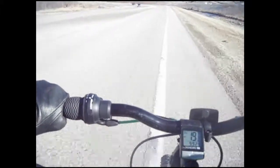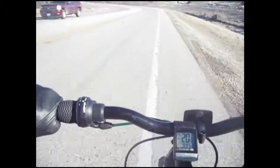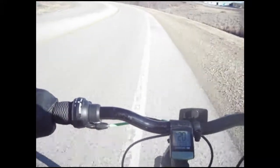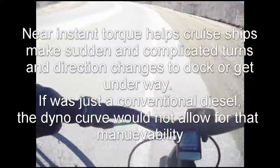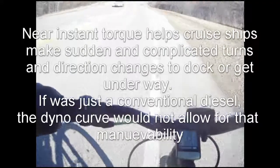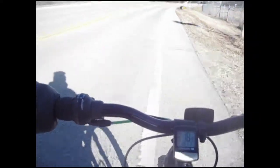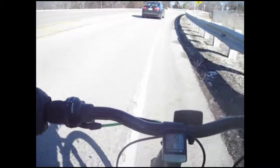So then I thought about it a little bit more. I went on a couple cruises, and modern cruise ships have diesel-electric drive — they have a diesel generator and that electricity drives an electric motor. For a cruise ship, that is the most efficient and practical usage of power, because the electric motors allow them to have almost instant torque for propeller speed to maneuver.